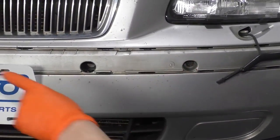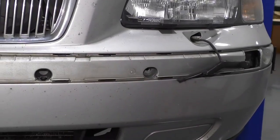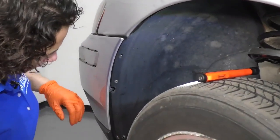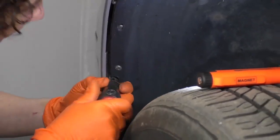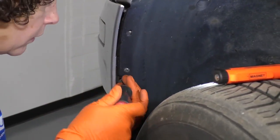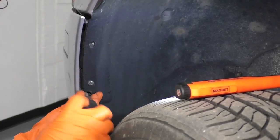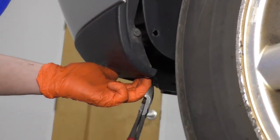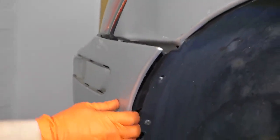Next, I'm going to remove these two mounting bolts in the front — it's a 12 millimeter socket. Now in the fender well on the driver's side, I can see a little Torx head right here; it's a T20. This car looks like it's been in an accident — there's a lot of things missing. I've noticed that someone wire-tied the bottom part, so I'm going to cut that right down here. I'm going to give this a pull back and see what else I find.